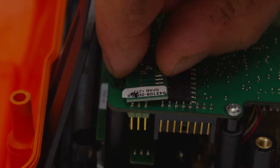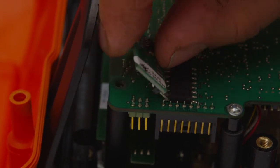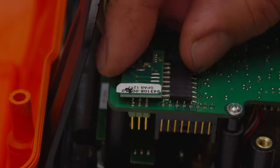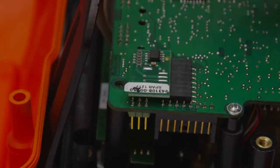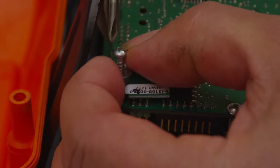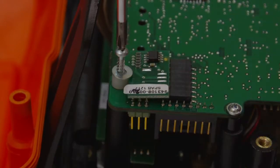Gently remove the SIM card. Assemble the SIM card on the SIM card contact. Tighten the mounting screw including nylon distance and washer with 1 Nm.